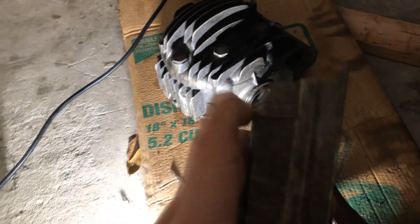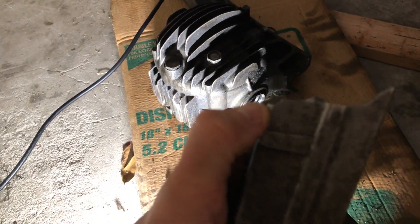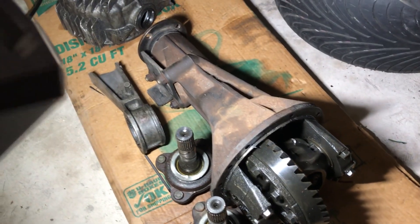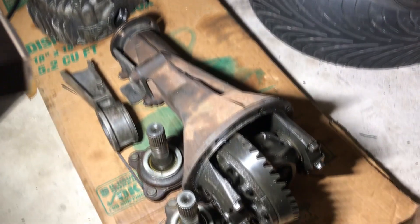Let me explain about the diff because it's a little complicated. Last time I made a video talking about it, people did not believe me, so I'm here to prove them wrong. This is my old diff — it's an LSD Torsen, I think off an NB. I snapped it clean right off on the ear. It's super common. Mazdas have this little notch right where my thumb is and it always snaps — the most common part that breaks on the diff. This is an RX-7 diff; I believe it's an NA diff, non-turbo, manual. As you can see, I have these two pieces here and I swapped the housing off the RX-7 diff and put it on the Miata diff.